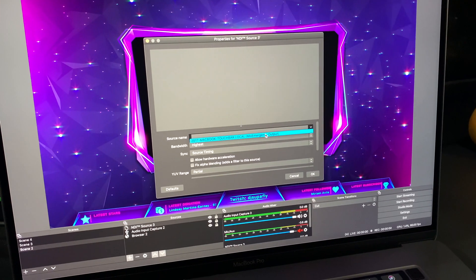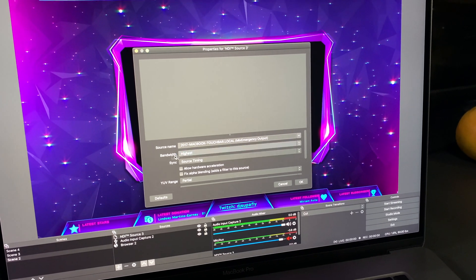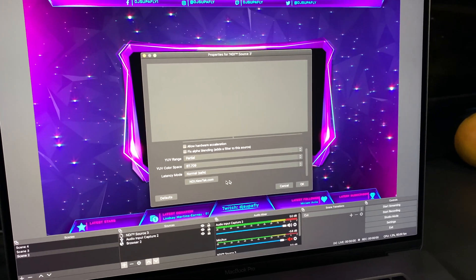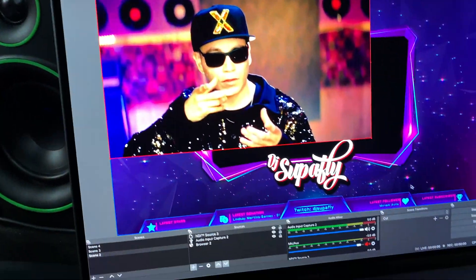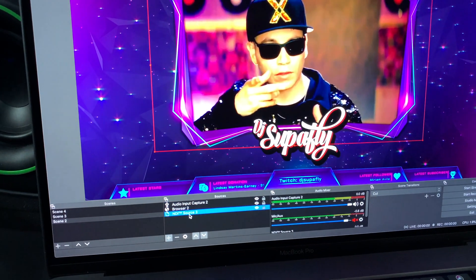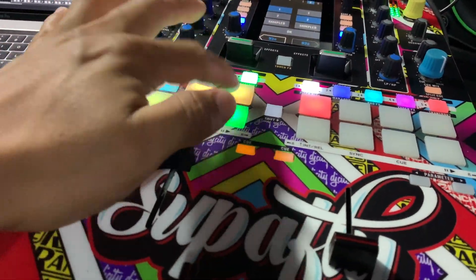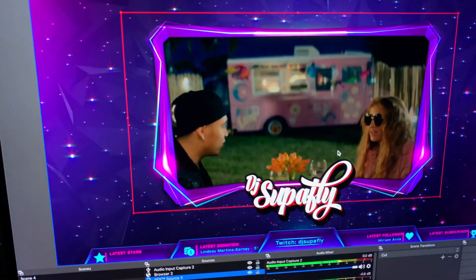Make sure you hit the arrow and select your MacBook there — that's my 2017. For bandwidth, I highly suggest you do the highest bandwidth setting. If you were doing this over Wi-Fi or a slow connection the video would not sync to the audio, but since we're doing it over Thunderbolt we'll go with the highest. And there's the screen — there's the video. So I'm just going to route this back in, play a track — I'm running internal mode, I don't have my turntables hooked up — and you can see the audio is synced with no skips.